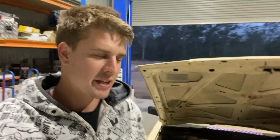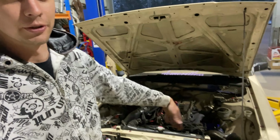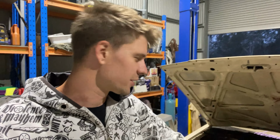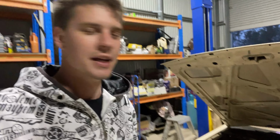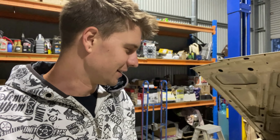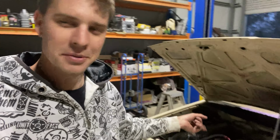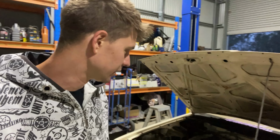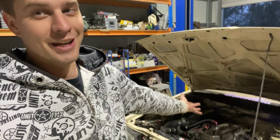Oh, yeah. All right, so it appears to be leaking pretty much the whole head to manifold gasket. Here I was like, yeah, I'll just reuse it. I'll coat it in copper spray. Didn't work. It is deadly leaking, so bad. I knew using a secondhand gasket might turn out bad, but holy crap, I can't believe that literally the whole thing is just leaking. So anyway, evidently can't get away with that. So it's all got to come off again.